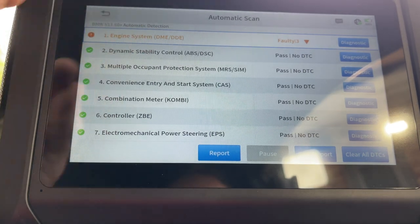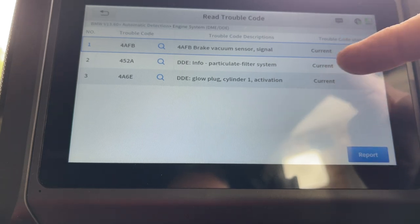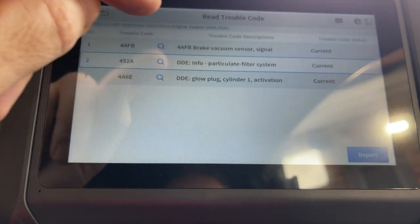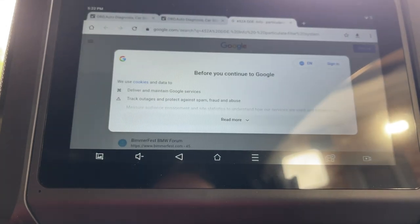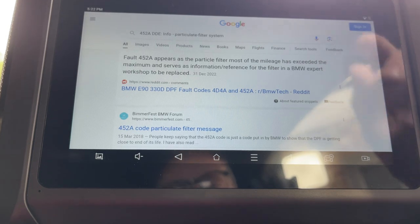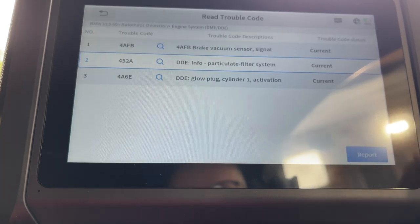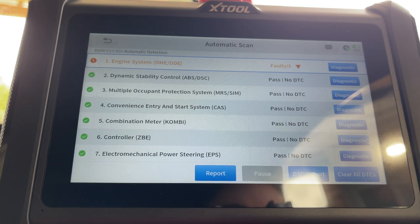Going into parking distance warning status. I'm pressing the button — that's working. Reverse gear, powered by ultrasonic sensors, 8.5 volts supply voltage — fault is stored. It gives loads of information to help diagnose the issue. There's a little magnifying glass symbol that takes you to an internet search for the faults — it goes straight to Google and gives you answers. For the engine system, we've got a vacuum signal fault — the 452A code. Let's do a Google search on that. It's saying the particulate filter has exceeded its mileage.